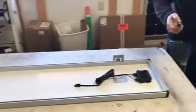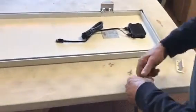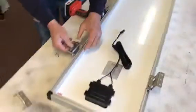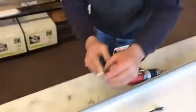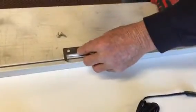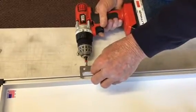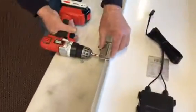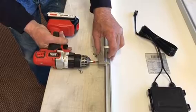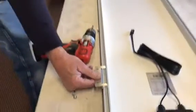The shorter side, which would be the inside part of the Airstream, is just like this here. All you would simply do is take and mark where you want it, set it right here. You see the holes here — it goes just like so. These screws here are to mount it. They go through the side of the frame right over here and they are self-tapping, so they will go right in there by drilling. We're not going to actually mount them at this time, but you're going to have one on this side and another one down here.